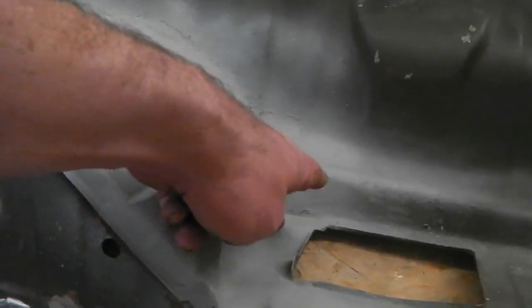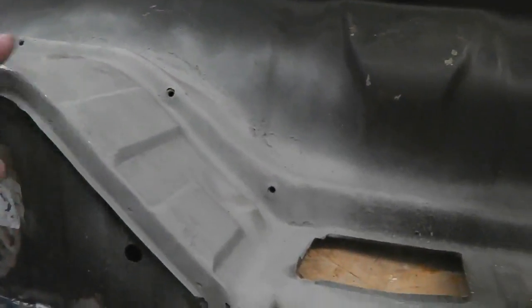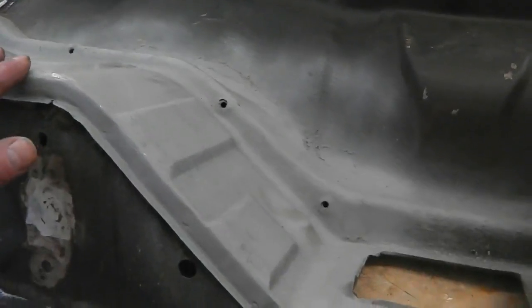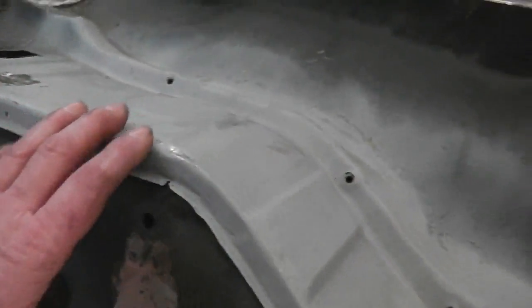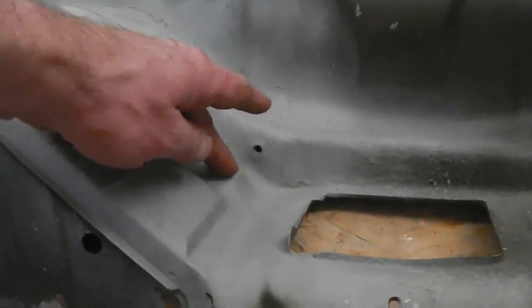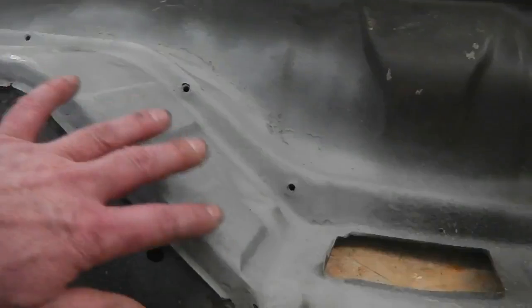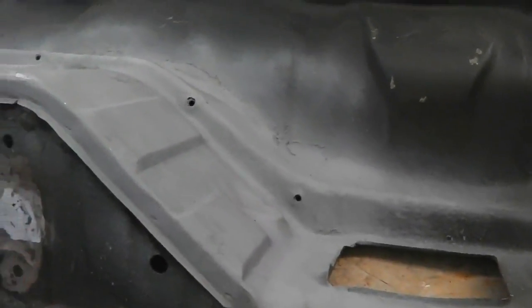This section was the usual welding along this line. That piece is out of Bramble, it's the original piece of Bramble's bulkhead that's been grafted in. There's the join, so that we can get it looking right, the pressings here, here and there. That little dome is not present on a facelift bulkhead. I didn't want people to look in the engine bay and see these pressings missing.